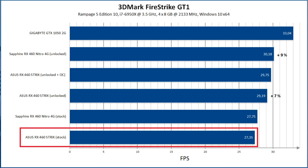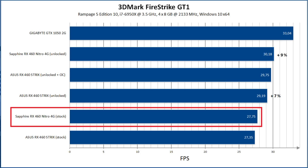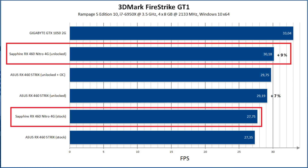The question for me was how much performance can you gain? In theory, percentage-wise, the same as the shaders — though clock speed also comes into play. The first thing I tested is a 3DMark Firestrike GT1 test. I tested the RX 460 Strix and the Sapphire Nitro card — both on stock and both unlocked — and also the Strix card with a little OC, then compared it with a GTX 1050. You can see that you gain from around 27 FPS to 29 FPS on the Strix card — a performance boost of 7% — and from around 27 to 30 FPS on the Nitro card, which is a gain of around 9% by unlocking the shaders.